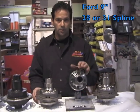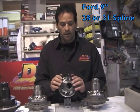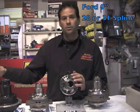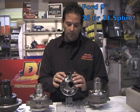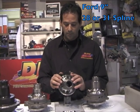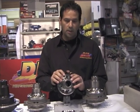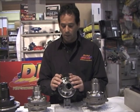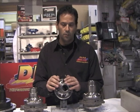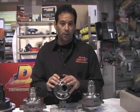One of our most popular differentials is our Ford 9-inch. This comes in 28-spline or 31-spline gears. All our gears across the whole line of differentials use 9310 material — we've found that to be an extremely tough material that withstands today's horsepower. The 9-inch differentials can be used in street rods, road racing, and circle track racing. They are just tough. The new Platinum Series features a whole new gear design with our preload mechanism.